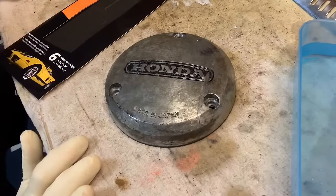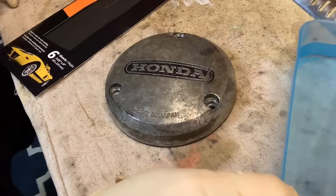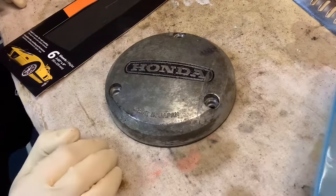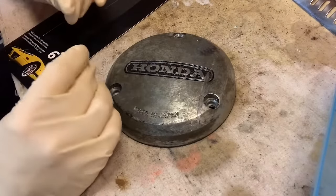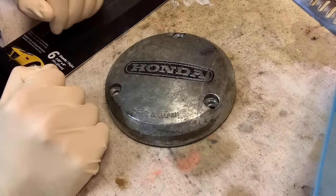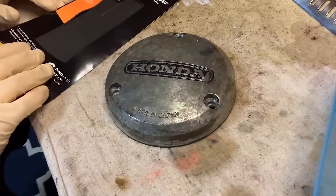Sometimes you do have to start with a 400, and that can really lengthen the process. You're also going to need some water — just a small little bucket of water. And when you're sanding aluminum, wear gloves. This stuff is nasty. It leaves a gray, nasty film all over everything, so I highly recommend that.